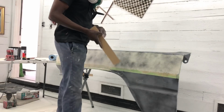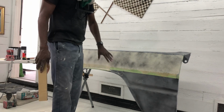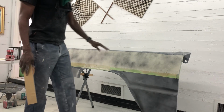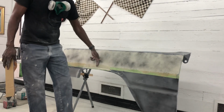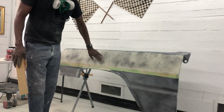All right, so now we have this kind of knocked down, leveled off. I can tell that it's actually pretty straight. I've got a guide coat on. I've kind of feathered the edges so that I don't have to build those down. And of course, we use our laser level and our level to get the trim line. So we're working down to this line to rebuild it.